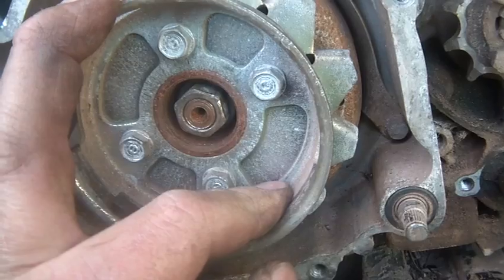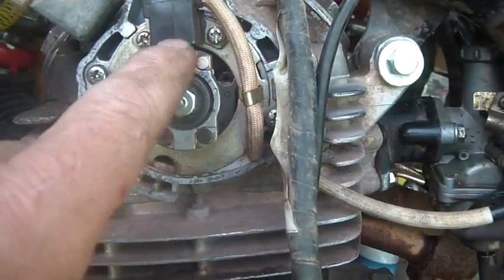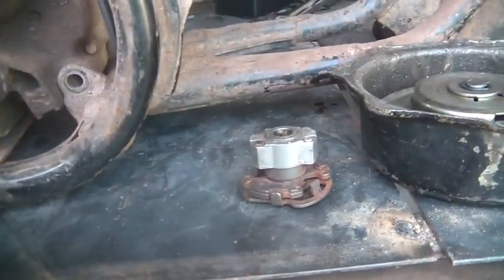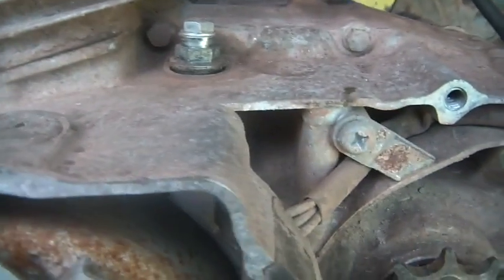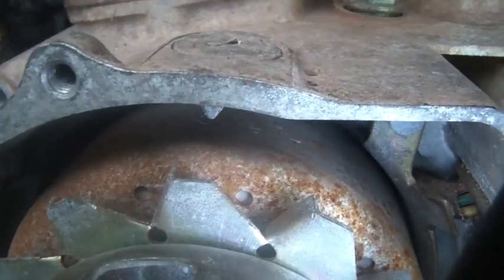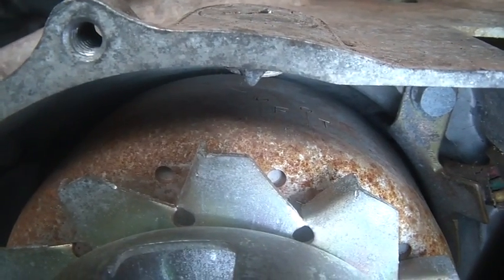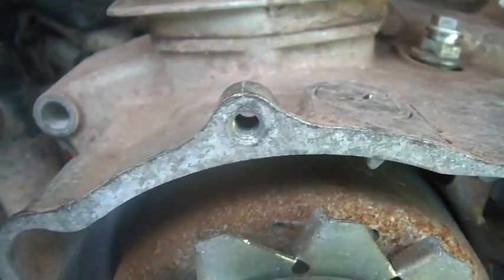You want to make sure that your cam and your flywheel are all timed together properly. The way you do that is you rotate this around, and you look for where these two line up. If you look in here at the engine you're going to see a couple of marks - you're going to see this thing sticking down from on top first, then attempt to look at the flywheel. Hopefully you'll see a little dot - with the flashlight you can see kind of a T, and to the left of that an F, then a circle.